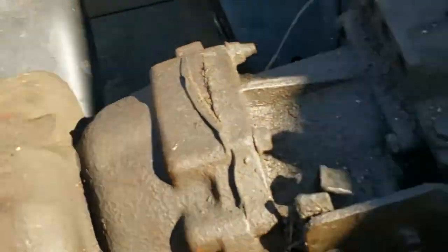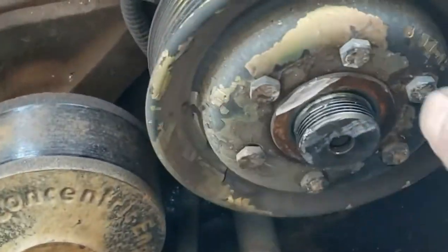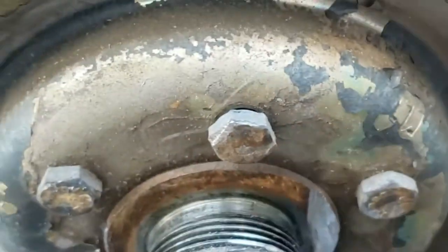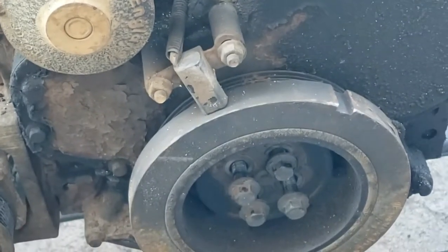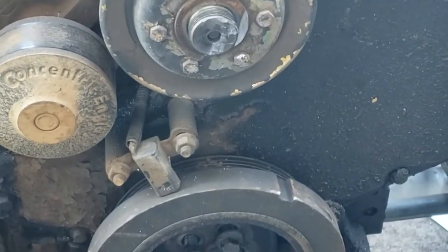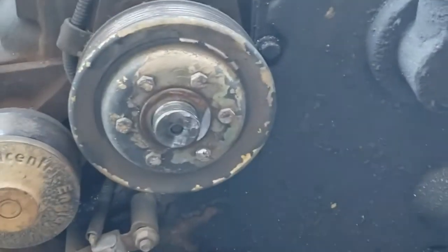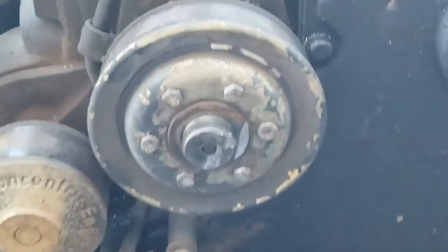Anyway, I went ahead and got my fan off, which was definitely a job. I actually ended up cutting it with a reciprocating saw and then I ended up having to grind down through the other piece to be able to get it off — there's a little gouge there, but I don't think I did enough to hurt the water pump. I looped the ratchet strap across it and tightened it up to the point I was afraid of starting to damage the water pump. I bent the fins back on the fan because I knew that needed to be replaced anyway. I beat and beat and beat — I know it's a left-handed thread — and it just was not coming loose; it was completely frozen up and rusted on there. Got it off.